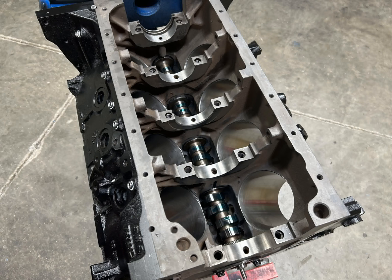The exhaust port helps scavenge the intake port. These heads were not worked over as far as changing the port dimensions, so it is literally a factory port. The camshaft was a 241/254 at .050. I don't give out all my cam specs — I've worked very hard to fine-tune these cams over the years through different cam swaps and multiple iterations of engines, and it's not something I like to just pass out.